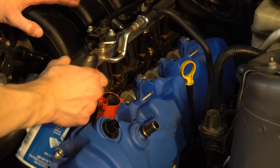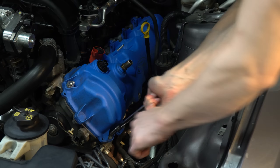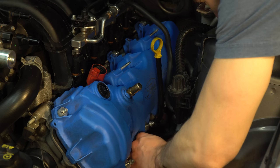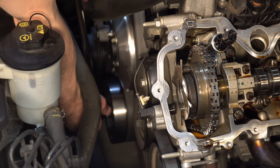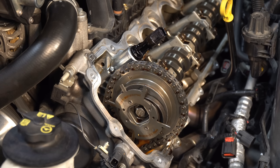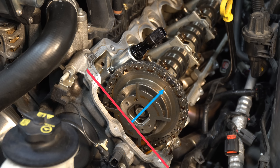Tuck the electrical bundle and its connectors well below and behind the head. Blow away any debris that could fall into the valve train once the cover is removed. On both valve covers, use an 8-millimeter socket. Remove the dipstick bolt and rotate the dipstick to the left so it's out of the way, then remove the valve cover. Use an 18-millimeter socket to rotate the crank clockwise until the cam phaser top dead center indicator is perpendicular with the plane of the head, positioning the phaser pin at the bottom.